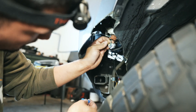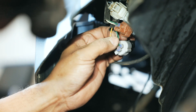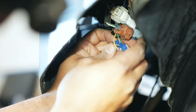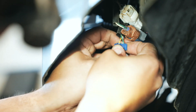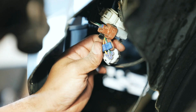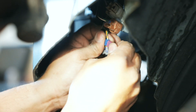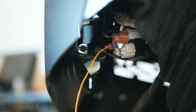Behind this bumper liner, look for the gray triangle-shaped connector — that is your turn signal. We're going to be tapping into the turn signal with the new Aiden James Customs bezel. On the driver's side it is a yellow color wire that you're tapping into; on the passenger side it's going to be blue. With the provided tap, put it in with the metal side towards the wire, then close that and use a set of pliers to squeeze it to make the connection. You'll hear a little clip — that's how you know it's fully installed. Then grab your yellow wire with the connector on it and plug it into the T-tap. Do the exact same to the passenger side, but just remember on the passenger side it is blue instead of yellow.